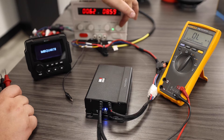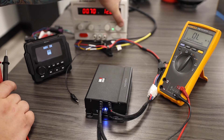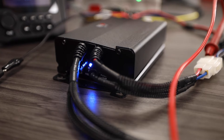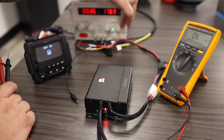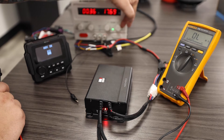At 8.5 volts they seem to be able to function. As I crank up my voltage, varying from 8 volts up to 17 volts, you can see that the red light has now gone on on my amplifier, indicating that I have hit a high voltage protection. Again, it has now hit high voltage protection. So if you have a bad voltage regulator in your vehicle or something causing high voltage, it will cause your amplifier to go into a protective state.